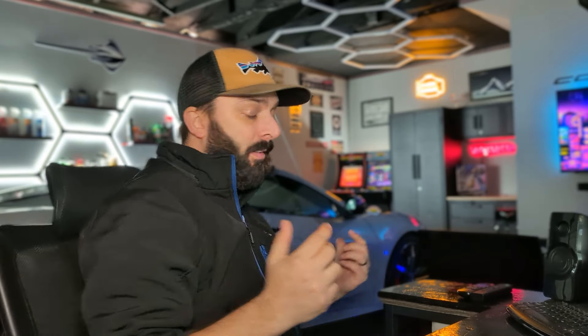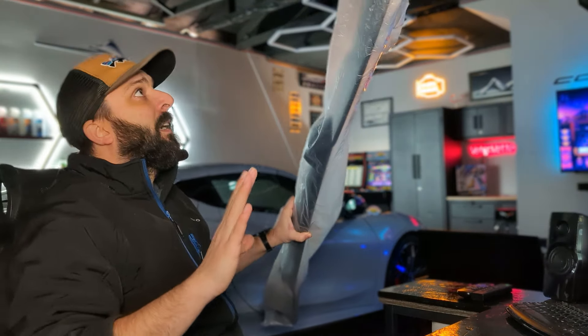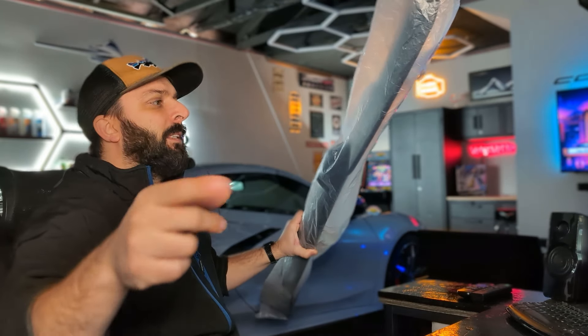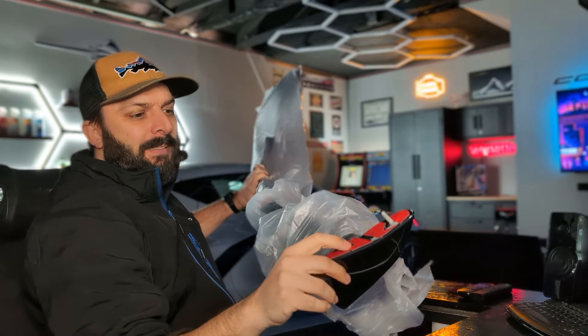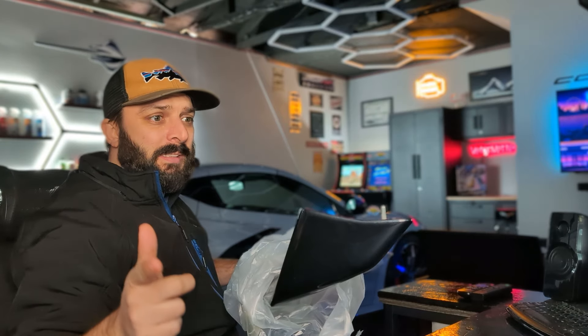This thing is so light. It came off my friend's 2023 C8 Z51 — we did a video on it a few months back. He went with a high wing and I got his spoiler. The only prep work I've done is put 3M sticky pads back where they belong on there. I've got the hardware right there. We're going to be drilling six holes — nine millimeter on the outside, seven on the inside. Let me collect my tools, get my drill, and we'll get to work.